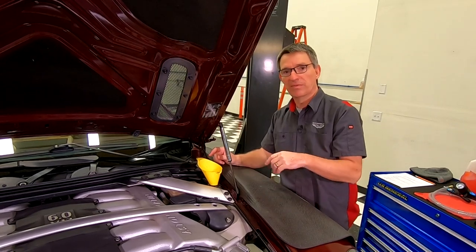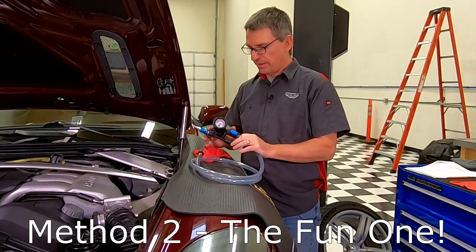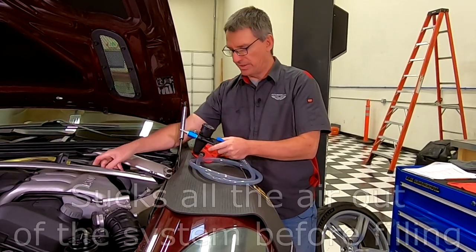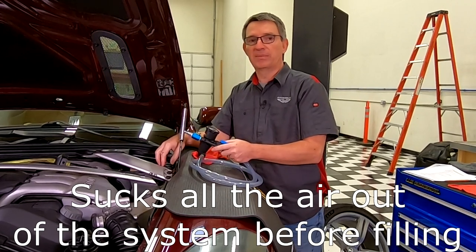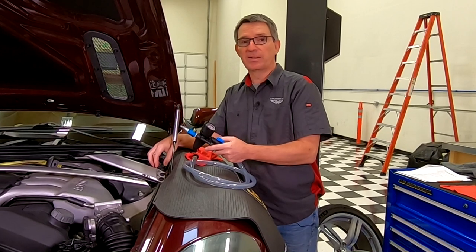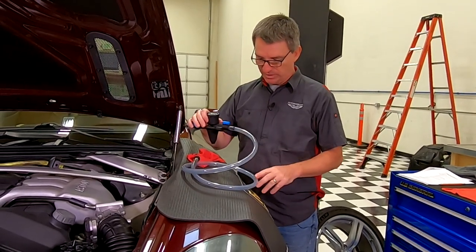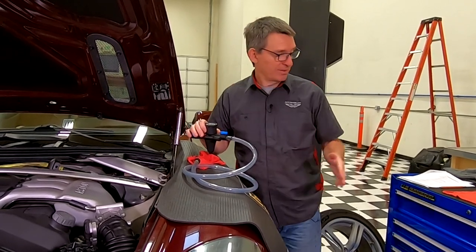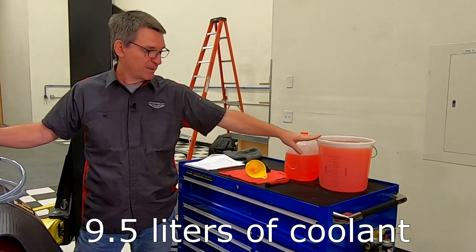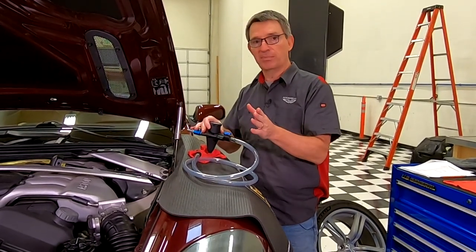The second method uses an airlift vacuum filler. Basically this is a tool I'm going to fit over the top - it has a tapered rubber cone and it requires compressed shop air. What it's going to do is suck all the air out of the cooling system. Rather than me needing to burp the air out afterwards, it's going to pull it out in advance - actually pulling about 26 inches of mercury vacuum on the system. Then it has a neat trick where it will allow me to slurp up all the coolant out of a bucket. I've pre-mixed about 9.5 liters of 50-50 mix ready to go, and it's going to suck it right back in. It'll only take a minute and there will be no air in the system.